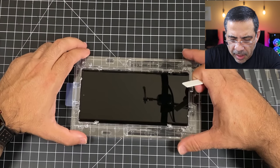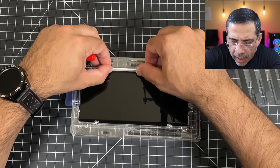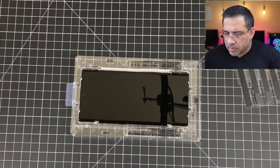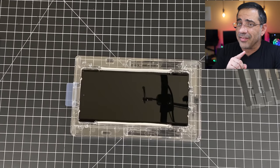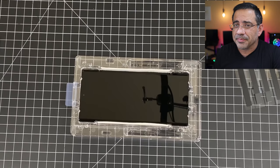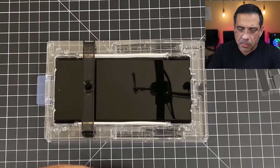What I'm going to do now is take the guides and place the tray right on top — it's going to snap into place. Then I'm going to put these little cotton strips on each side and they're going to absorb any excess fluid. I'll check one more time for dust. Everything still looks good, so now I'm going to put this bridge in, and then we're going to put the adhesive. Make sure you're working on a flat surface — if not, make sure the bubble is in the middle.